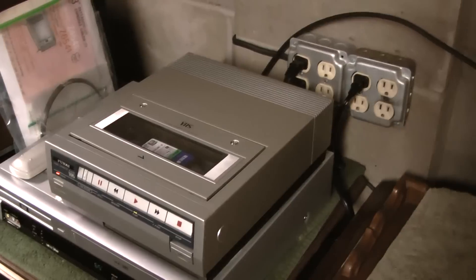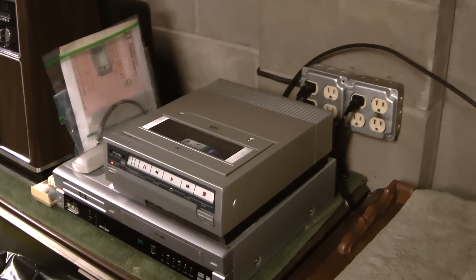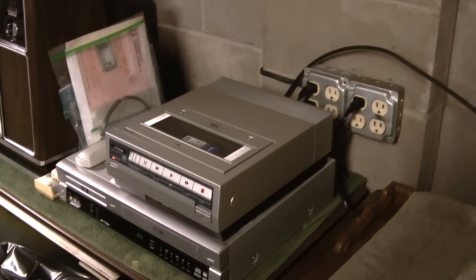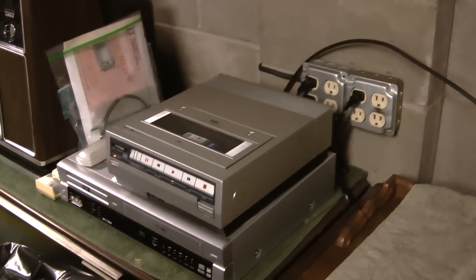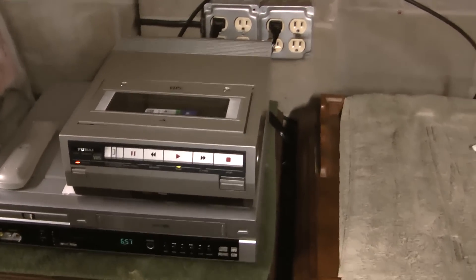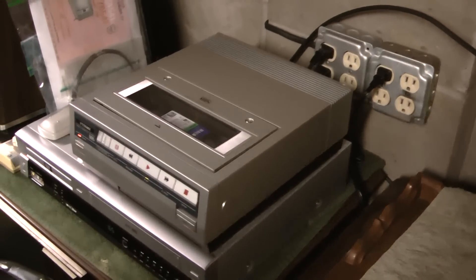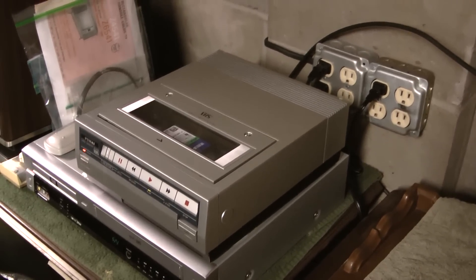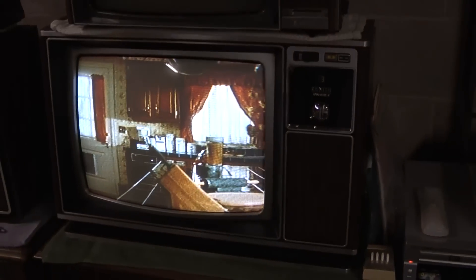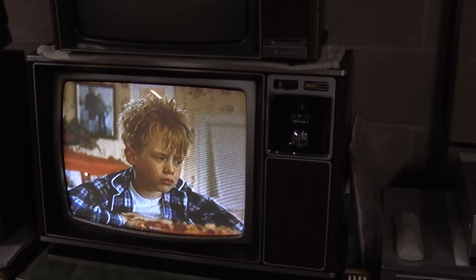The reasoning for most standard two-head VCRs having smaller heads — in terms of track width, gap, whatever — is because you need the smaller heads to prevent cross-talk between tracks. If you use standard play heads on an extended play recorded tape, it's not going to work. With two-head machines they optimize it for the smaller tape speed. Ideally it's 19 micrometers — that came out later, but newer VCRs aren't good, so you really didn't notice a difference. Picture quality-wise, does it make a difference? You bet. This gets a much better picture than a regular two-head three-speed VCR. Much better.